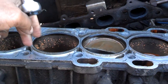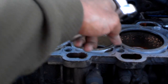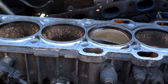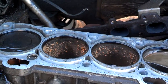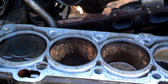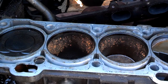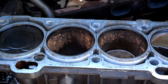When I cleaned the block, I took some paper towels and put them down the coolant ports so that the chemicals didn't go down into the block and contaminate the coolant passages. As you can see, this head has been off the car about a week and the piston walls are already starting to rust, because the hood is open and it rained a time or two. So if you're going to leave the head off for a little while, keep those piston walls oiled and cover it with plastic to keep them from rusting.